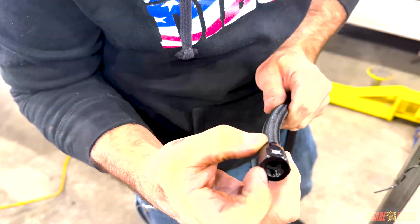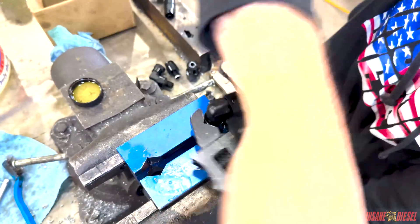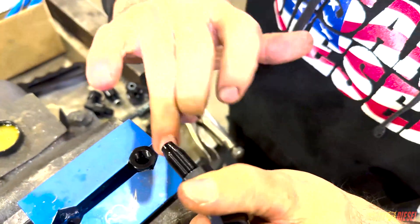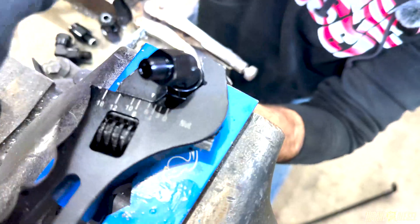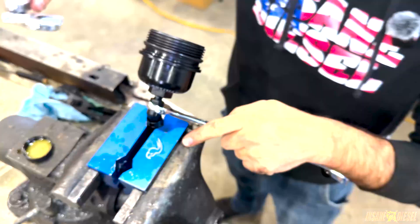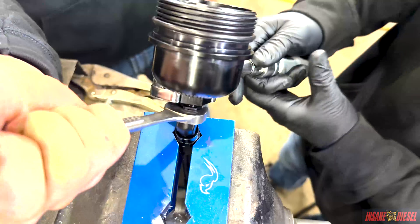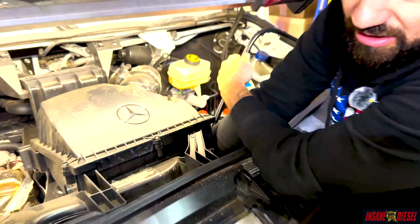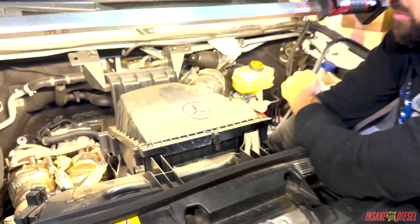You see it bottom out behind these threads. I'm going to lubricate this part of the fitting and hold the hose underneath — you don't want to let the hose push out of the nut. Lubricate the tip of this as well. On the filter housing cap, it's 122 inch pounds or 11 foot pounds, which is not very much. I'm going to lubricate this o-ring, then spin the filter housing cap back on. It's got a 45-degree fitting on it and it's really tight. If you need more access, you can actually take this air box off.